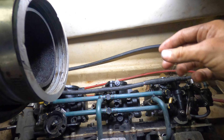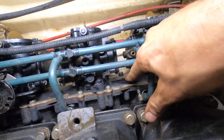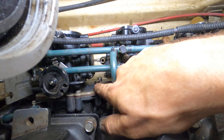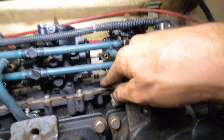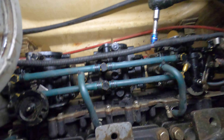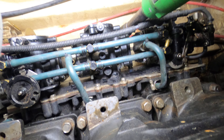On these carbs, when you do come to build them back, originally you have four spots — four bolt holes — that originally come with a five millimeter allen head with a holster plastic piece over it, so it actually holds on to your allen bit so you can place them after. These must be put on. This is incorrect — you can't run these carbs without doing this. If you don't put those on, that plate doesn't seal, it sucks air, leans out, and you fry your cylinders. A lot of people don't know this.